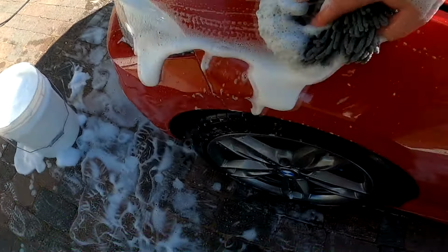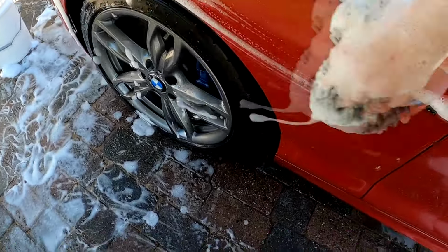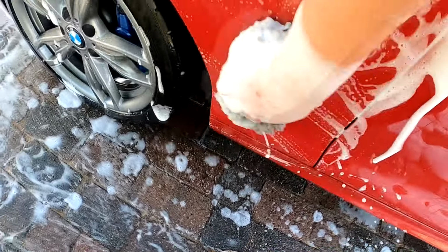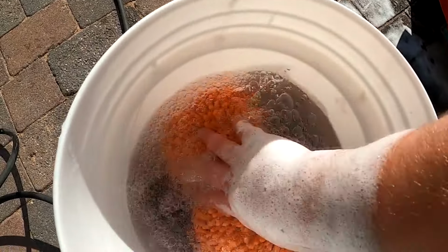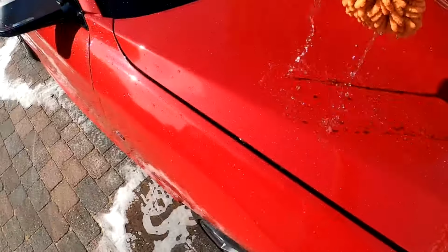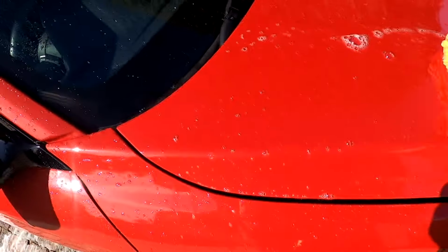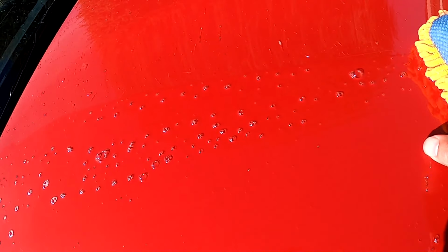Well, this will sud up, by the way. If you want it to sud up and you want thick foam, you can do that with this particular product. But here's the bombshell. If you use the same solution, but you don't blast it up to create all the foam, you just dip your mitt in it and clean the other side, and you get hardly any suds. You know, you might get the odd one because you agitate it a little bit. There is no difference because it's the encapsulation of the dirt with the liquid, the product doing the encapsulation and the lubrication. It's not the bubbles that are formed through blasting it up that do that.